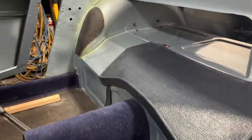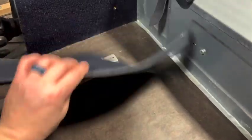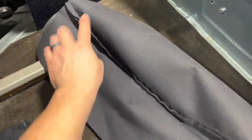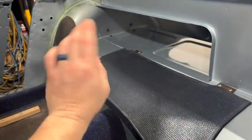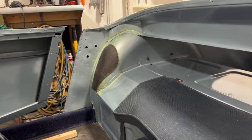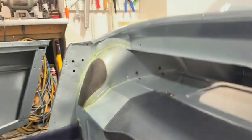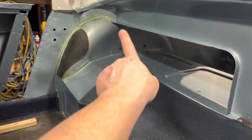Here are the actual wheel arch covers that I've sewn — you get that piece of piping. The way I usually do it is to glue up one face, stick it down, and then while the other side is folded open glue the other half. Doing it in half sections makes it a lot easier and you can get a lot tighter. As you put it on, pull tension along the piping to get all the wrinkles out — pull it really tight in both directions. Right in this corner is where your spare wheel block goes, so the wheel arch cover goes in first, then the spare wheel bag, then the triangular spare wheel block, which screws in from the outside.